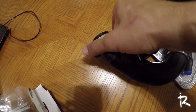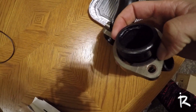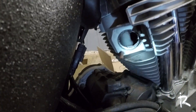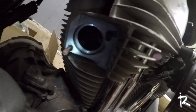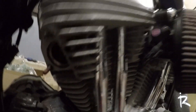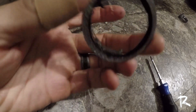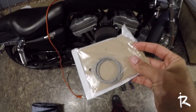I got the clips on — you slide this on first and then the retainer clip goes right in there. Before you can put the exhaust on, there's a ring in there that looks like shredded steel wool — you gotta get that out and replace it with a new one. I was able to get that out. It's basically a gasket — a steel wool type filling material. I got the new rings and I'm gonna put those in.